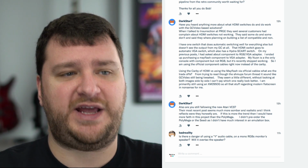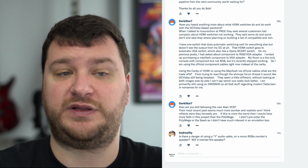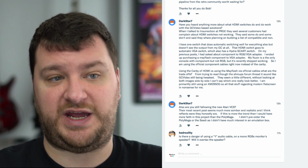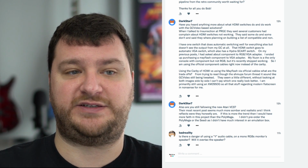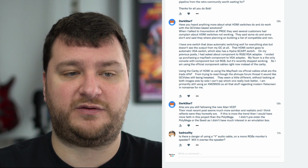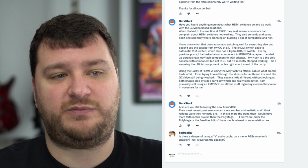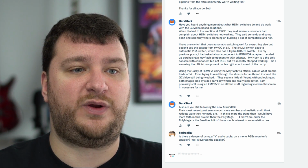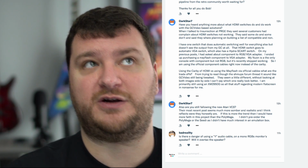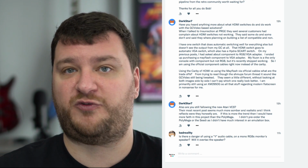But I believe the next part of your question, if I'm understanding correctly, is that you have all of your HDMI stuff, including the output of your GameCube, running through an HDMI switch that goes to a VGA switch, which then also has your VGA adapter at the end. And you're wondering if that's going to be better than something else running through your XM29. To be honest, I would base this on what you already own. So if you already have a Carby with HDMI output, using one of the good VGA or HDMI to VGA adapters might just be the best solution because it stays digital for the longest time.